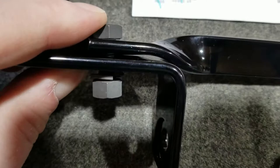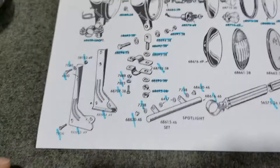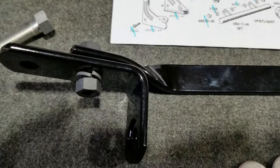These are real parkerized, machined-type bolts. They don't have CP stamped in them or '1035' or anything like that. These brackets were all black — they don't think they were ever originally chrome, because they were mainly used on bikes during the war years, about 1942 to 1945.